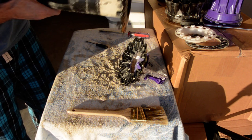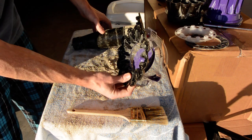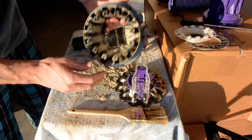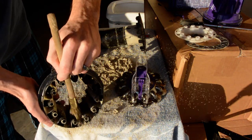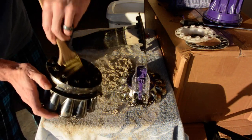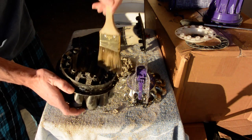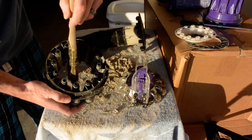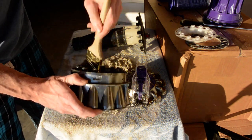You've got a nice little screen right here if you want to clean out underneath it. That right there is a 100% complete dismantle of your canister filter. The brush comes in handy to clean it all up inside that area to get that deep clean. Some people like to put it under water — I don't, because it takes forever to dry and I want to put this back together and use it again instead of waiting for it to dry. If you leave a little bit of water in there, that can cause more buildup than what you had before.